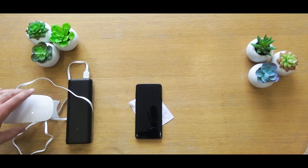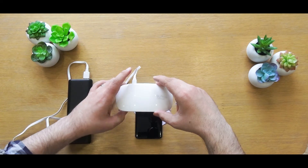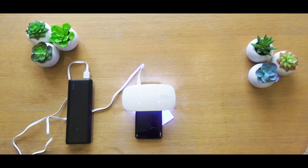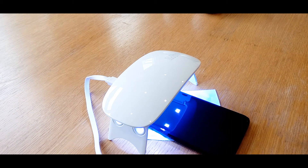Once you're satisfied that your phone is nice and clean, take the UV lamp and complete the curing process by placing it over the top half of the screen for 75 seconds, then repeating a further 75 seconds at the bottom of the display. This helps to ensure that all of the adhesive underneath the screen protector is fully adhered to the glass, meaning there's no danger of the screen protector coming off accidentally.